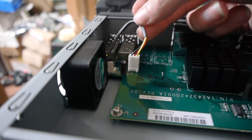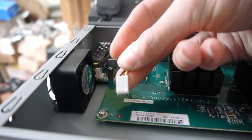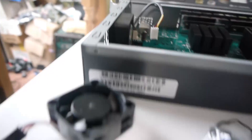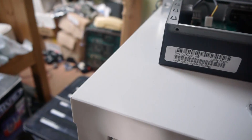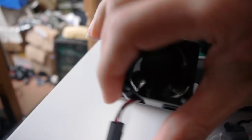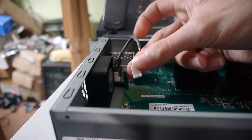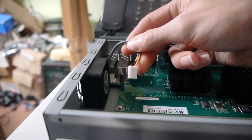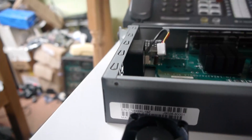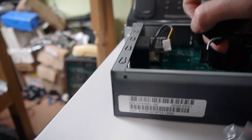I just thought I'd take a moment to pay attention to the original fan. The pinout on it is black, red, yellow with the indented side there, and the new fan is pretty much identical. The reason I say this is because some network switches - Dell and probably the newer HP ones - have decided to mess around with all the wires. But this switch is old enough that it still uses the exact same standard connector.